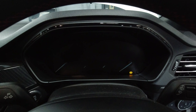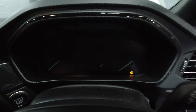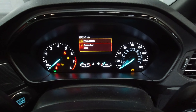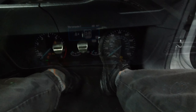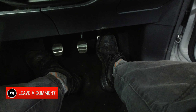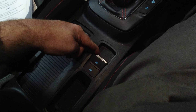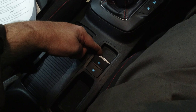Now that you've carried out the repairs to your brakes, to deactivate the service mode turn the ignition on. As you can see, the warning light is still in the bottom corner. Then fully press and hold the accelerator pedal down to the floor, pull the park brake switch fully upwards and keep it held there.